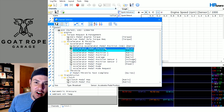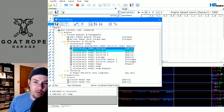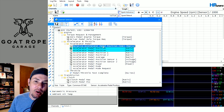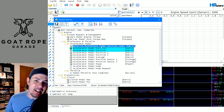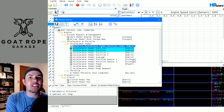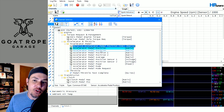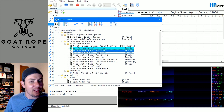What it's often going to do is put you on the SAE version. With the SAE accelerator pedal one, this is where you see things like the accelerator going from 20 to 75 percent. That's because it's looking at a voltage and transcribing that voltage into a percentage that does not necessarily match what the ECM looks at — which is zero to a hundred percent. So you want to use the non-SAE version in those situations.